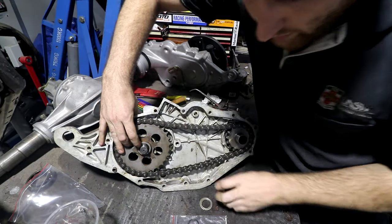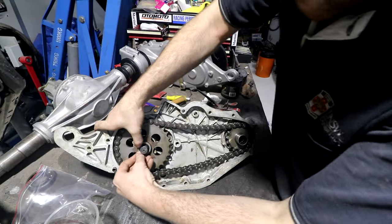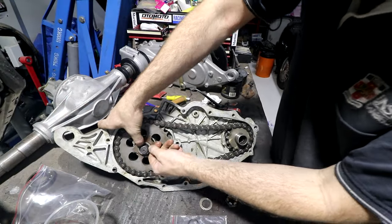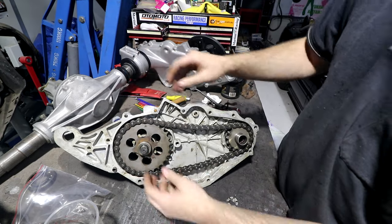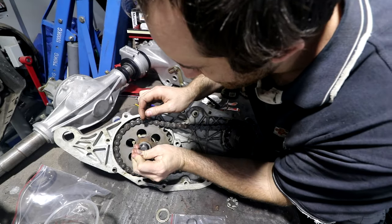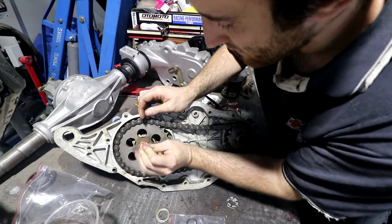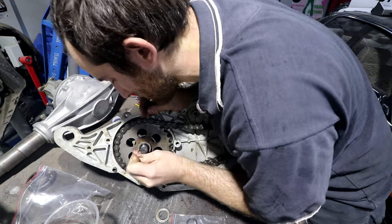So make sure this O-ring is pretty fat to go in here. It is definitely the right one, because like I said, I have the original one. But we'll make sure it's in its groove all the way first, because if I just slam this on there and tighten it down, it's going to squeeze the O-ring out the sides if it's not sitting in place properly. Because the O-ring does actually fit down inside this gap if I squash it in there properly. With this Allen key squasher.